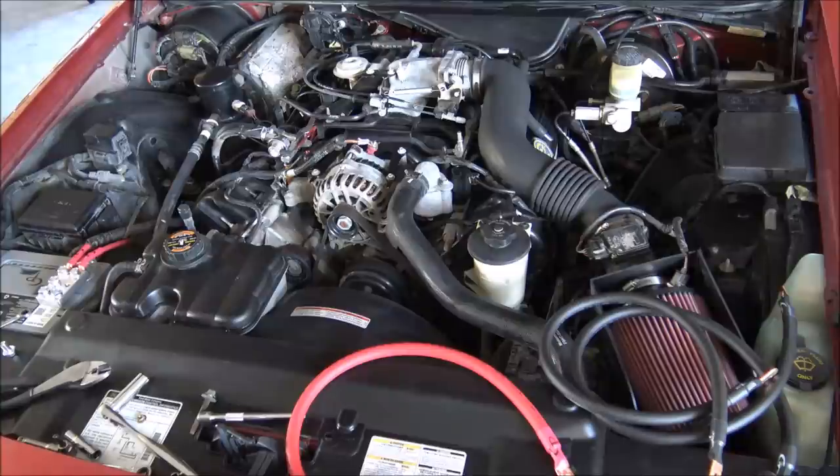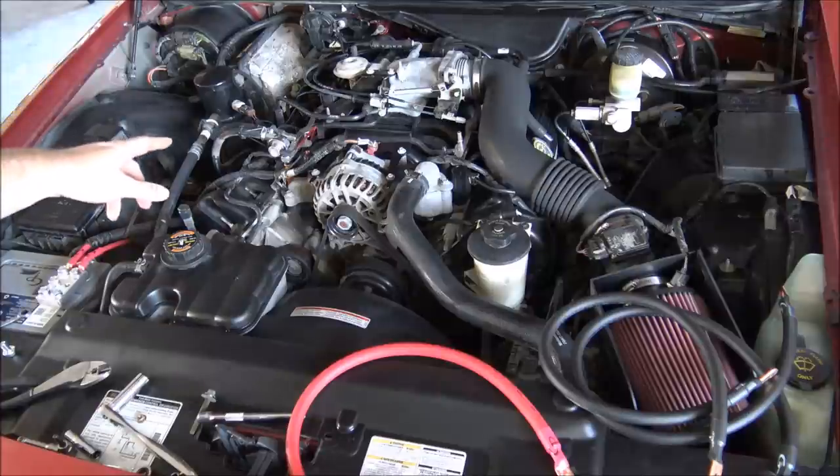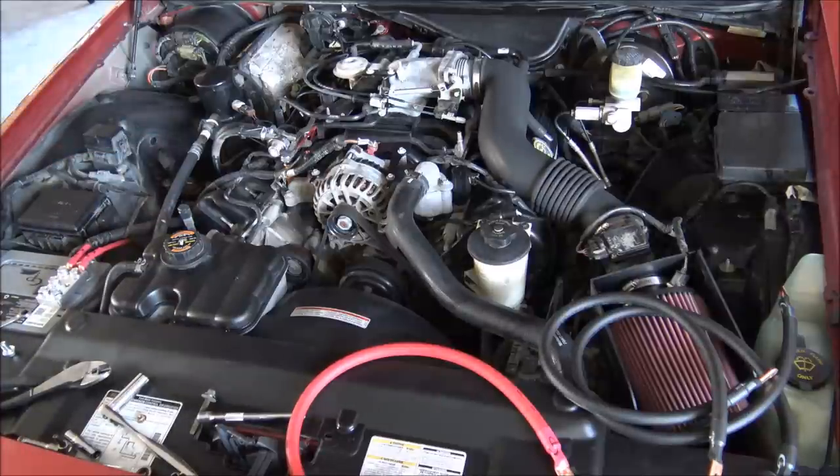This is Mike's Grand Marquis and we're getting ready to put a system in it here shortly. We figured we would go ahead and get the big three knocked out, followed by getting the wire ends ran to the back and all that — secondary battery, yada yada. So we dropped in a North Star AGM-65 under the hood with the GP SAE machine terminals right here. We're gonna go ahead and get this big three installation started.